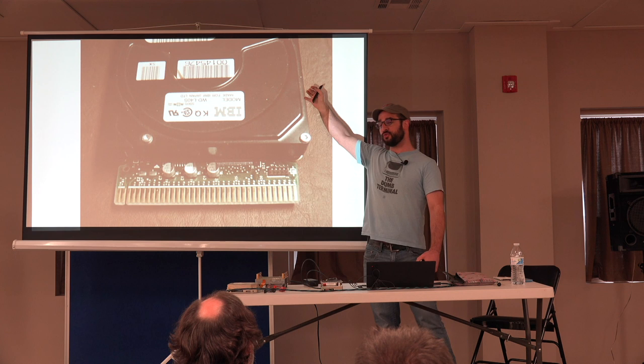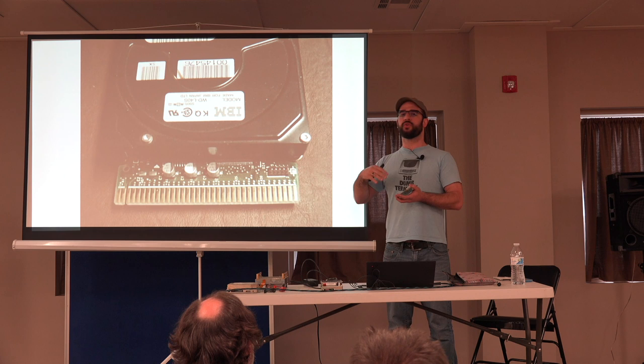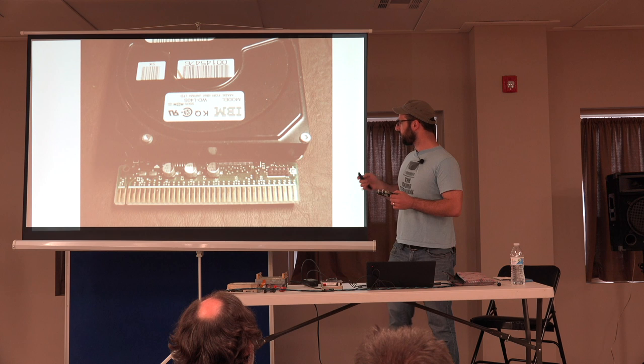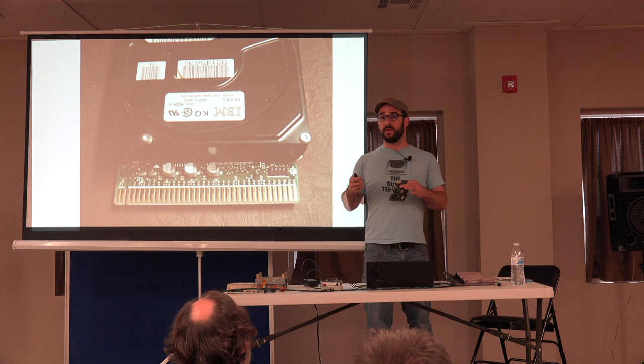Because the controller is actually on the drive, the reason they call them direct bus attachment is that the connector is essentially hooking the drive onto the Micro Channel bus. It's not a host adapter. The control signals going over this aren't like the actual magnetic transitions that you'd be getting over the cables on an ST506 drive. That's similar to ATA? Yes, similar to ATA in concept.